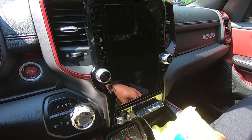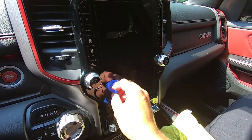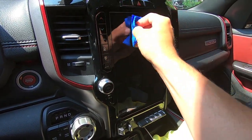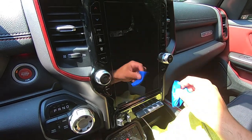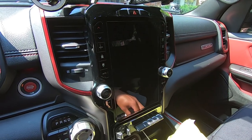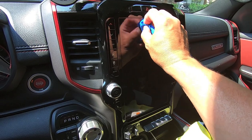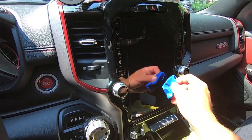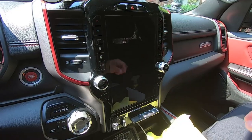Isopropyl is done — everything's wiped down. Every so often I get a little dust in there from moving in and out of the truck, but you want to make sure there's nothing on there when you apply the wetting solution. Keep flipping sides on your microfiber and push that dust off. It goes without saying but make sure you have clean hands — especially when wrapping things with clear wrap or paint protection film — you don't want any grease on the screen itself.